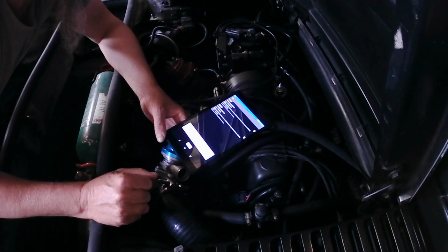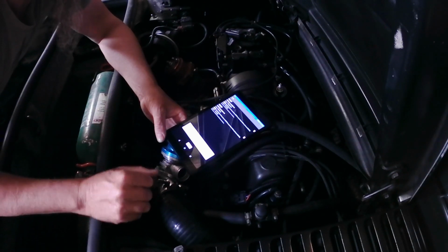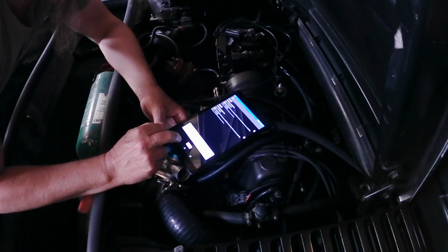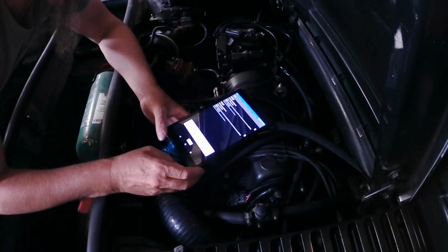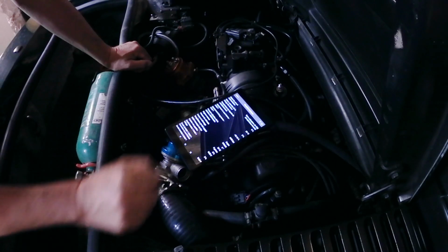It reads too low and doesn't send any meaningful signal to the ECM. This makes the car idle very badly, well, even worse than usual. It also gives a nasty hesitation on acceleration, just not really good. Should be 1 bar.